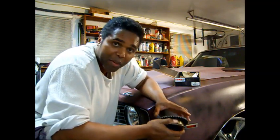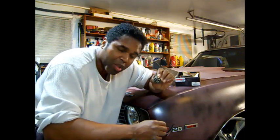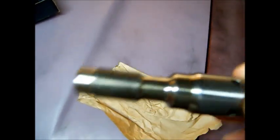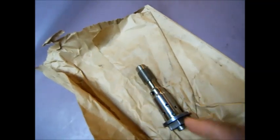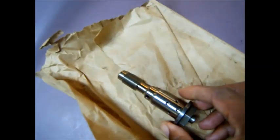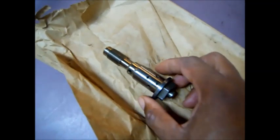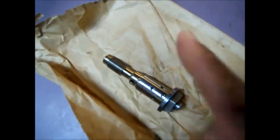That's pretty much what I have to say about the VVT. I hope this answers your questions. Oh, and by the way — this is different than the cam sprocket I had. This is the VVT cam bolt. Look how thick this thing is — it goes in just like this. It's a one-bolt, and this is torque-to-yield. When you torque this thing down, you have to put a degree twist on it, and the bolt actually stretches. That's why you can only use this once. The head bolts, crank bolts, and a couple of other bolts on the LS engine are torque-to-yield — meaning you can only use them once. Once you torque them down they stretch and you can't use them again. This is a one-shot deal. That's what a VVT cam bolt looks like.